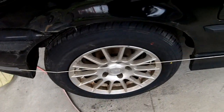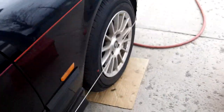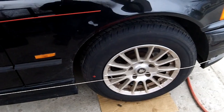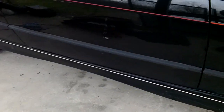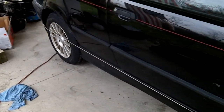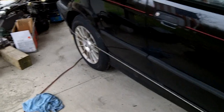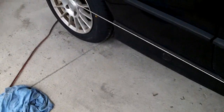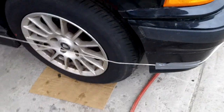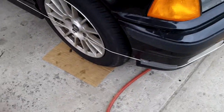And if you looked at my last video, you'll see that all cars — all McPherson strut cars — they don't really have a lot of adjustment up front. They just have toe-in. So this car, before I took it apart, went down the road straight. All four tires wore evenly. There's no reason to believe it has anything major as far as an alignment problem. So what I did, I put a piece of mason twine around it. You can see the white line there. It's about halfway up. I got it about even up and down around the car.